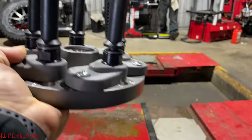The spring behind that, when I put this on it, that's nice. I had it in this hand and the razor in this hand, right? When I put this on here behind the collar, what am I doing when I crank that butterfly down? I'm compressing that spring a half inch further. Therefore, I'm putting more pressure on the assembly to hold it steady. Because what will happen, have you ever balanced a tire and you know in your mind you got it tight?